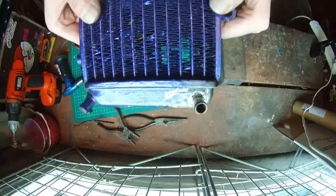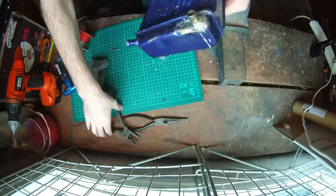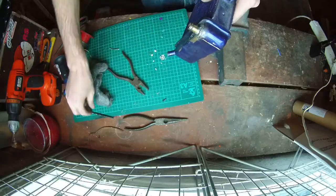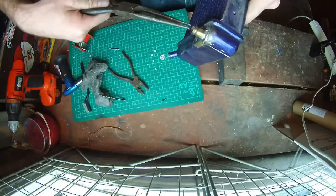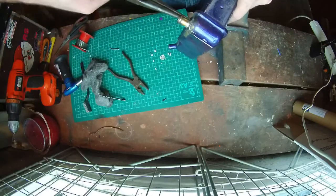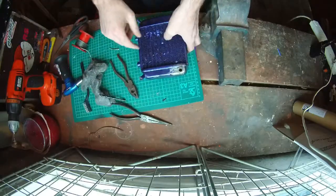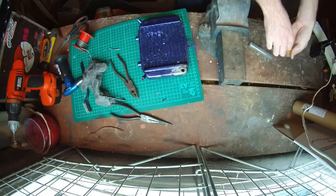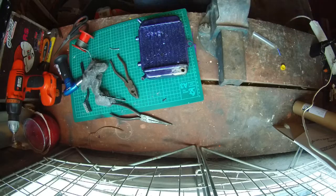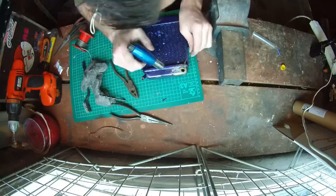So there we have it, starting to be soldered on. I mean, it's got its strength back, even though it's still very hot. It's no longer loose at all. And that should hold pressure now. Now it still feels a little bit soft in certain areas, so I'm going to go over again and just do a little bit of extra soldering. I just want to find some slightly different solder. I'll just go around and use this with a bit more flux to get in there.